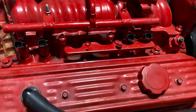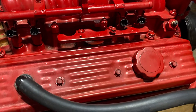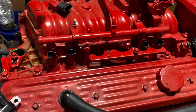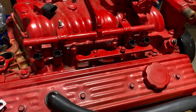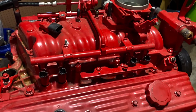Get these injector rails off, swap out all the injectors with different injectors, and put it back together — that's all you have to do to make this MEFI computer and MPI system run a 5.7 when it used to run a 5.0. I have the injectors precisely sized to do that. But again, that's a trade secret I'm not going to share in this video.